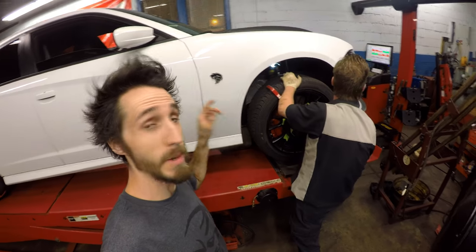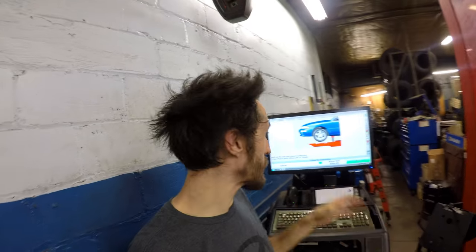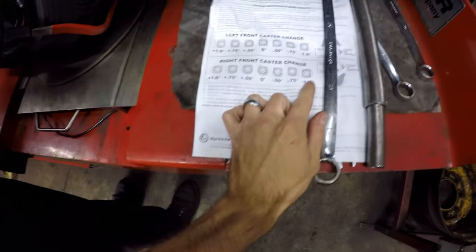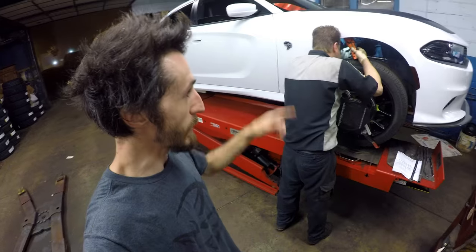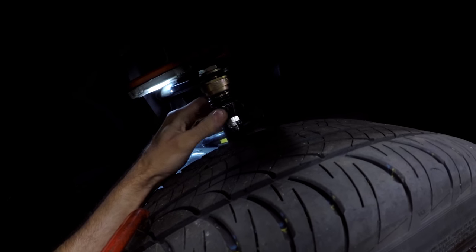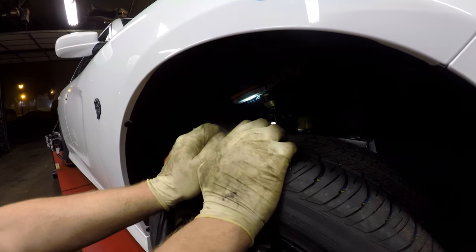Now that we've re-rolled the car, we're going to adjust the caster on the passenger and driver sides, then adjust the camber a little bit, then do toe on the whole car to make sure it's good. We're making the caster adjustment right now by spinning it. We want the full 1 degree on caster to get it down to 9, and the other side will be about 8.6 or 8.7 — which is almost picture perfect. He's got to raise the upper control arm, then spin it on top of the spindle and rotate it to adjust the caster where the washer holds the caster adjustment. When you spin it, this piece will go up, giving more negative caster — we already have 10 and only need 9, which is max adjustment going towards the negative.